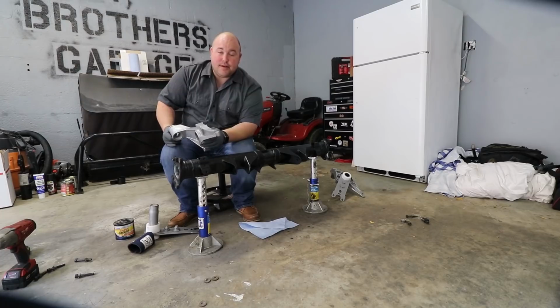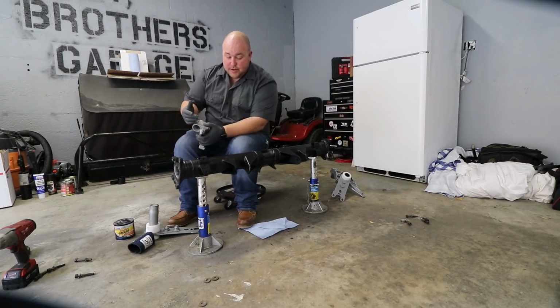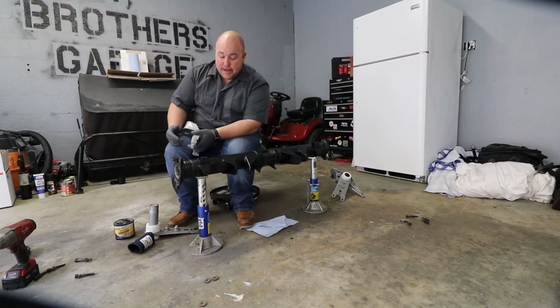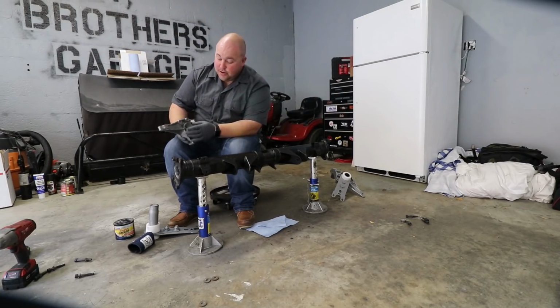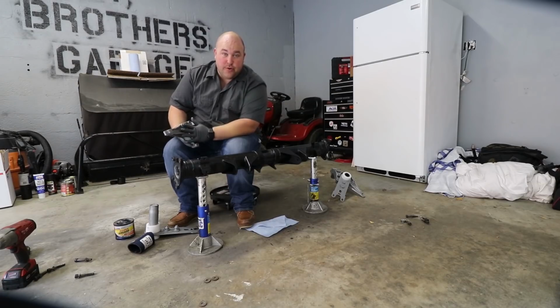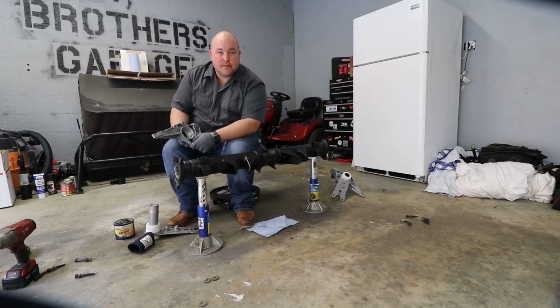I had my buddy Alan come over who has done this exact project before. He's also a mechanical engineer, and we went over everything, and he said when he did his, he ran into the same issue. He actually wasn't even able to get his bushings all the way in the carrier arms and to turn by hand. But once he put everything in the car and had a load on it, it kind of worked itself in, and everything started working correctly. So that's where we're going.